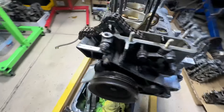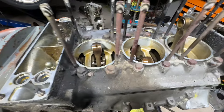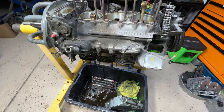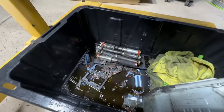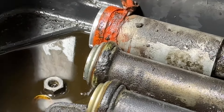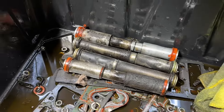Surprises on this motor: silicone in the wrong places. But I don't see any fragments anywhere in here. The oil was really, really clean — that's why the inside of the motor is very nice. But look at this: they replaced these tubes and you can see the beautiful silicone. That silicone is just wonderful — no, don't use it, do not use it. These are collapsible return tubes. We will be putting new ones in there.